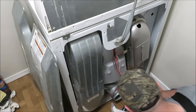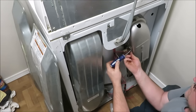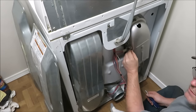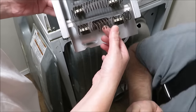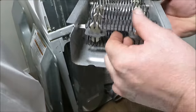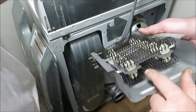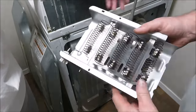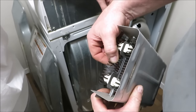I've got the heating element out, now I'm going to take the fuse out. I'm not sure I can test the fuse to see if it's any good, but I do know I can test the heating element. Julie's already found it — it's broke, right there. I was wondering if I broke it when I took it off. We don't know for sure — let's see how brittle it is. They still feel pretty strong, so I'm not sure how that one would have broken just from that little fall.